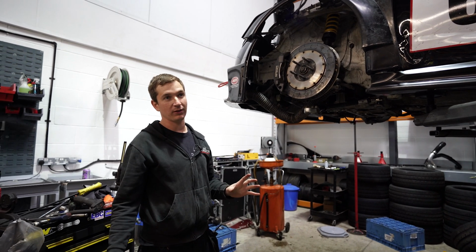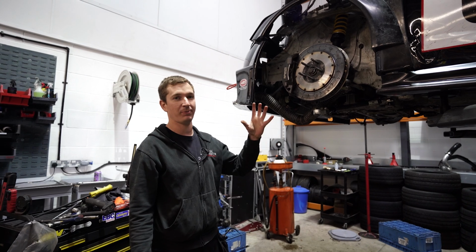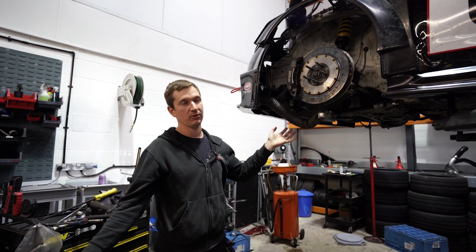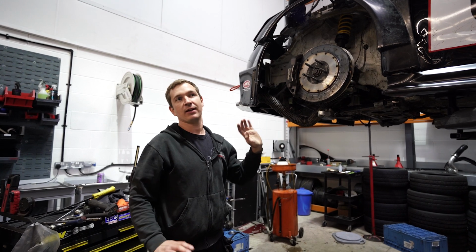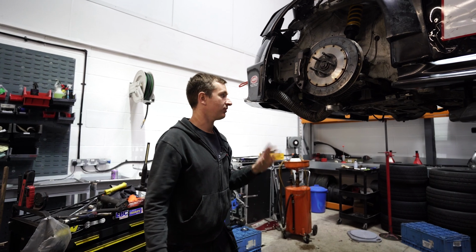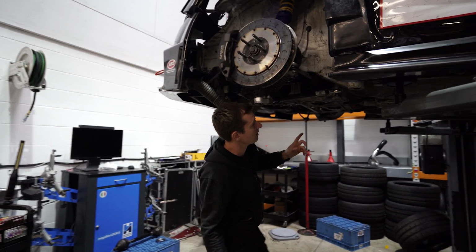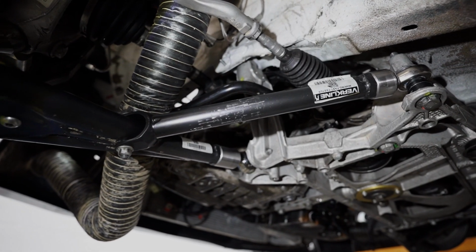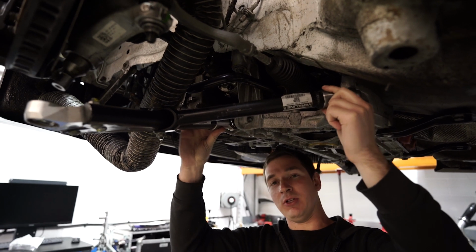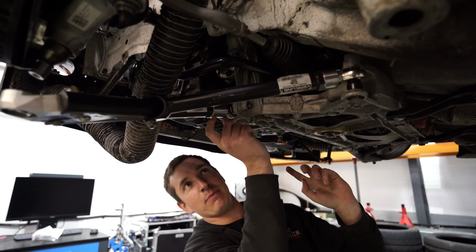What we wanted to do as well, because an 11-inch wheel and a 295 won't fit no matter how much we space it, and just spacing the wheel is not good for your scrub radius, which means you're just going to destroy your tyre. So we decided to go even wider on the arms. Verkline didn't want to build any wider arms for some reason, not sure why. So we made these as a quick test. We made these little spacers that were literally just wind in to the arms, tighten them up, Loctite them in. That's made the arms that much wider.